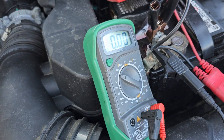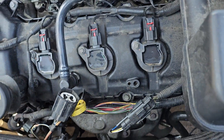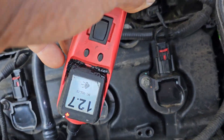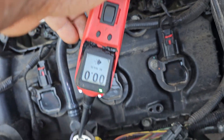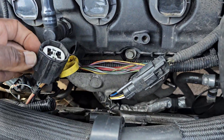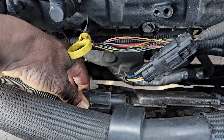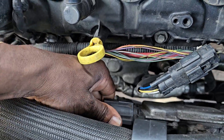You see nothing — this is zero voltage, which means it is ground. If you use a relay or a tester like this, you see here I have 12 volts with sound because I have power. You put it on ground — ground with sound. Now you're putting power and ground and you connect them here in this module. Push it and you must hear a click — yes.